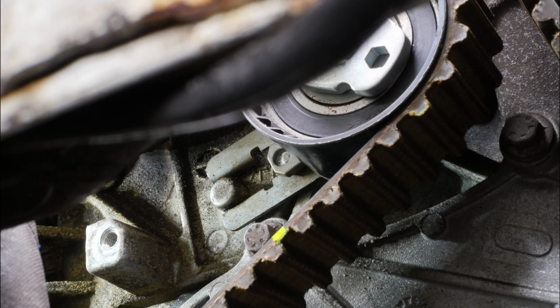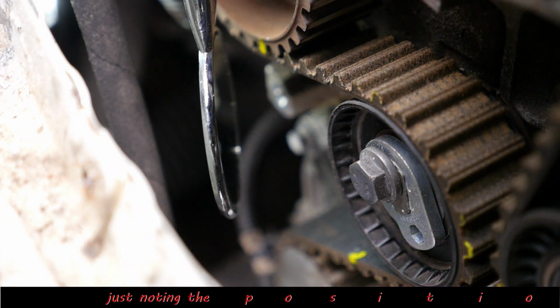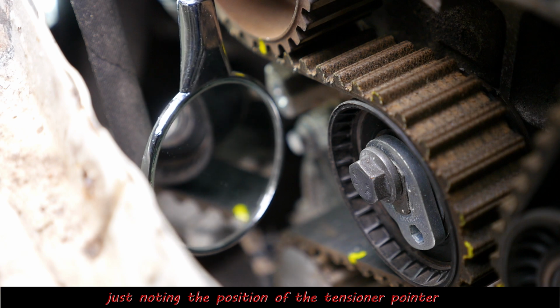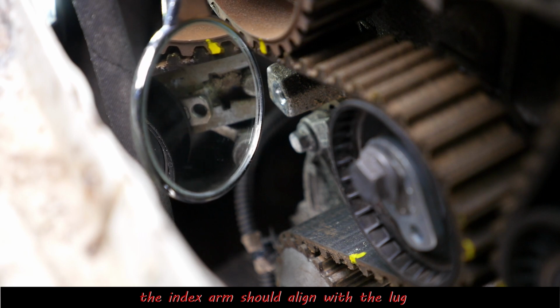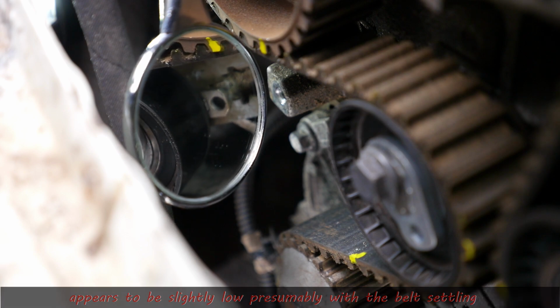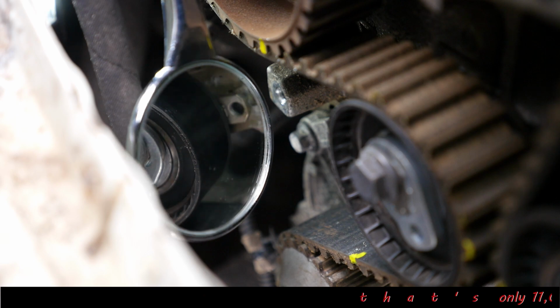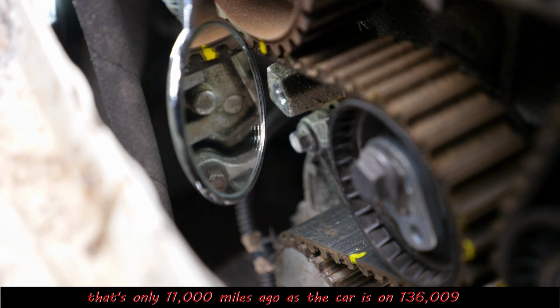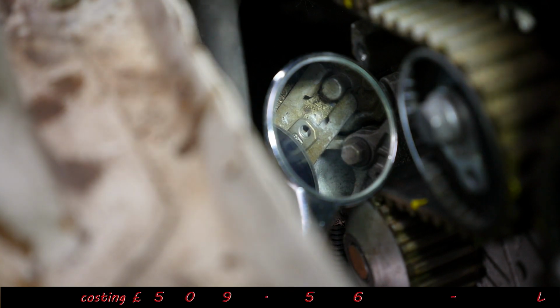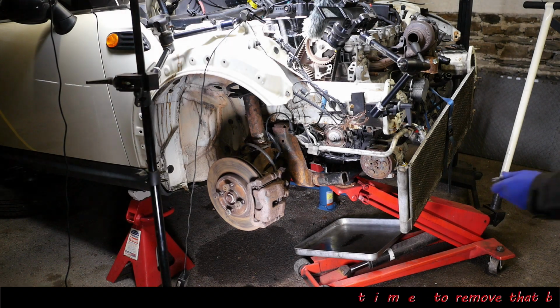So it might be worth just showing the tensioner and how it aligns with the alignment lug there on the left, and that should be in the middle. So just try and get a mirror down here and let's see where that lug or the alignment marker is on my engine. So it's actually a little bit low there. So presumably as the belt wears, that lever will actually drop lower and lower. But it's not central. It is just slightly off. I'll try from a different angle there. You can just see it there. It's got the hole in the middle of it. All right then,